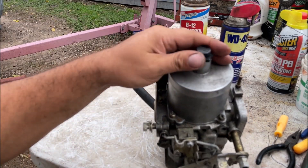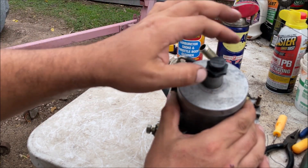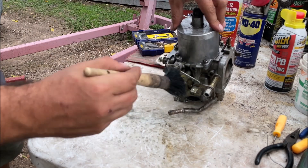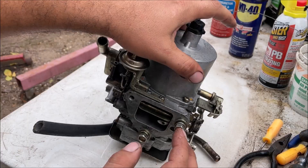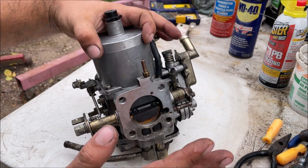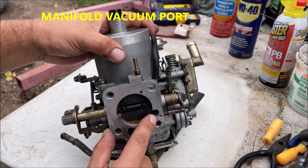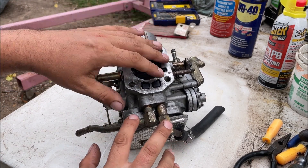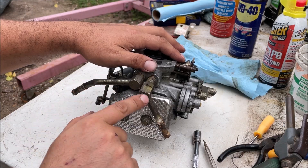What is this little thing up here? It's like a little dipstick, an oil thing. First, let's get some of the nastiness off the carburetor. The air comes in from this side right here. When that butterfly is closed, this is the intake manifold port right here. Notice these two lines - these are water lines, so the carburetor is water cooled and the fuel bowl is also water cooled.